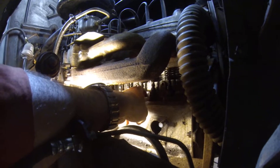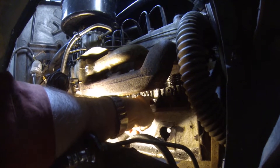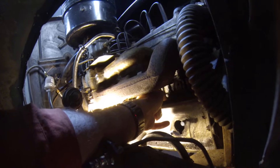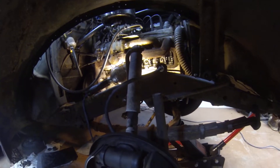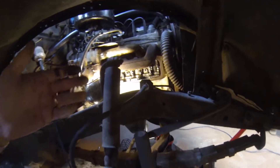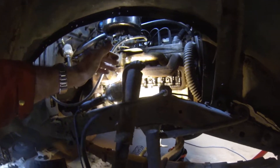This engine is decent. These little oil pools here — pockets — are designed to hold oil for the lifters, and there's a fair bit in there. I pulled out a good chunk on my finger. I'm going to clean all that out as best I can. I'll use a solvent spray gun, spray solvent and wipe out all those pools, get all that old sludge out, and brush it down with a brush.